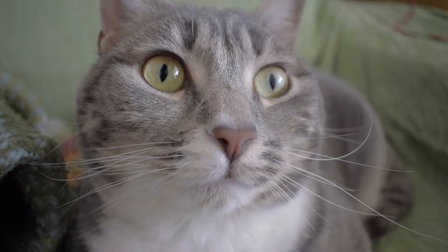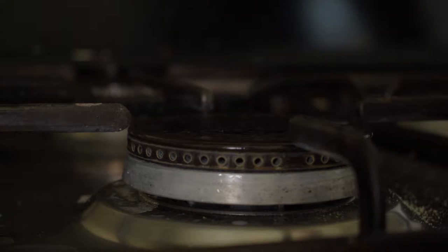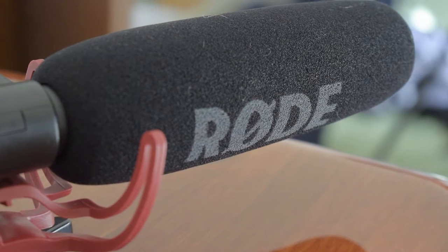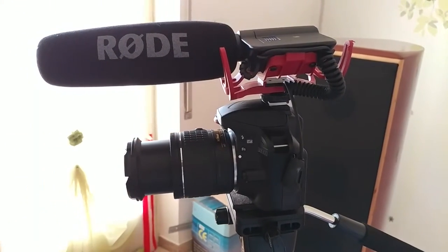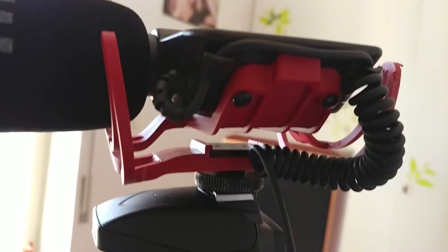What is this noise? Most of my audio is recorded through this shotgun microphone. It has a good build quality and a good signal quality, except that the signal is pretty weak and some amplification must be done inside my camera, which has an awful and cheap audio system that adds a lot of noise with a high gain setting.